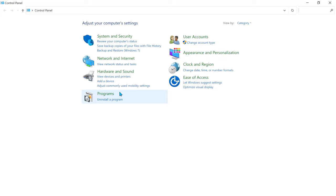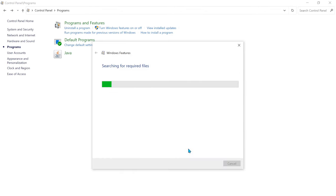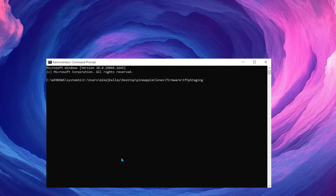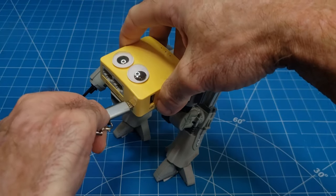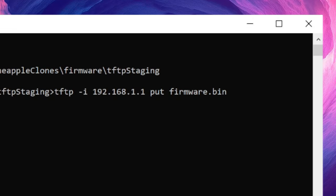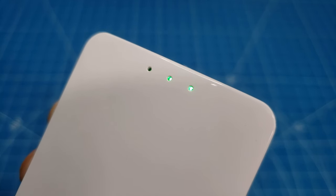To get this to work on Windows, you must first enable TFTP by going to Control Panel, Programs and Features, Turn Windows Features On or Off, and then check TFTP Client. You may have to temporarily disable your firewall or otherwise permit TFTP at this point. Open a command prompt and change directory into the folder with your firmware. Use the same recovery mode boot process as described before, and then in your command prompt type the following command: tftp -i 192.168.1.1 put firmware.bin. After the TFTP transfer is successful, the GLiNet router should automatically begin flashing the firmware.